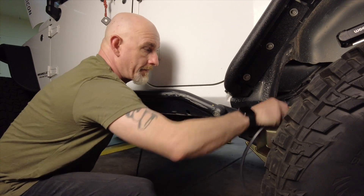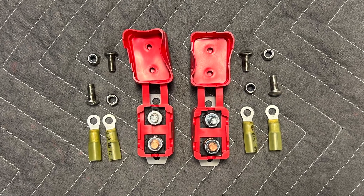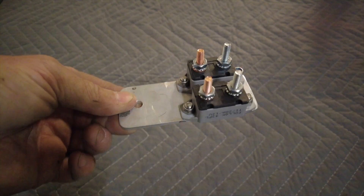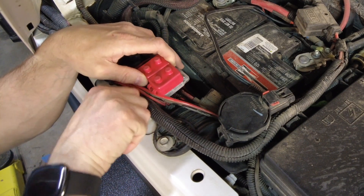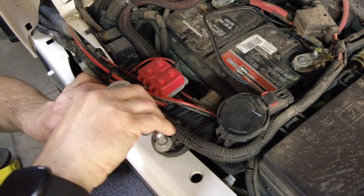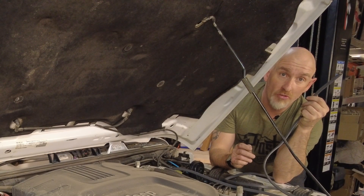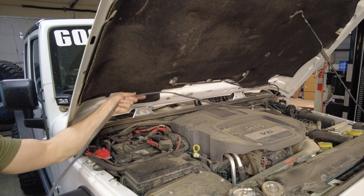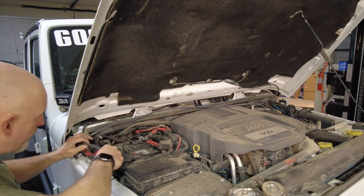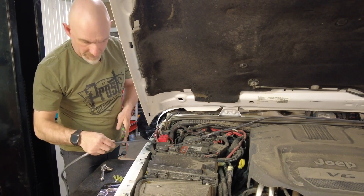I ran the supplied gray wire along the driver's side frame to the engine compartment at the front of the Jeep. Because I didn't want the circuit breakers to be exposed, I bought these circuit breakers with covers and made a bracket to mount them on, then mounted them on the passenger side fender close to the battery. There are two wires inside here. The black wire goes to the power for the trailer, so that needs to go to the circuit breaker on the passenger side. The white wire goes to the trailer brake controller output, so that needs to go through the firewall to the inside of the Jeep. I'm going to pass this wire across to the passenger side and make sure it's long enough to get to the circuit breaker, then cut it there.